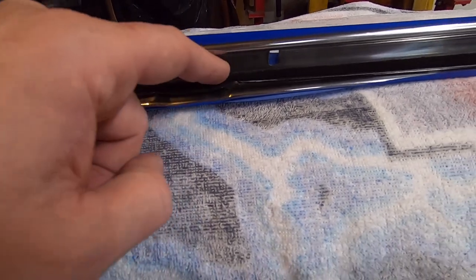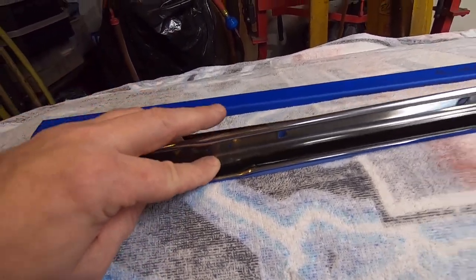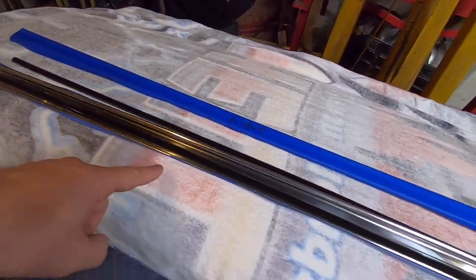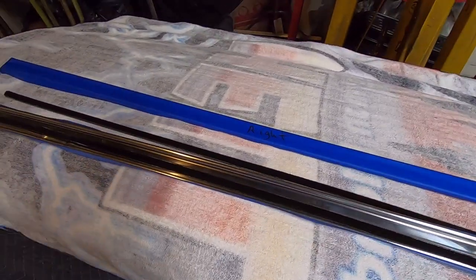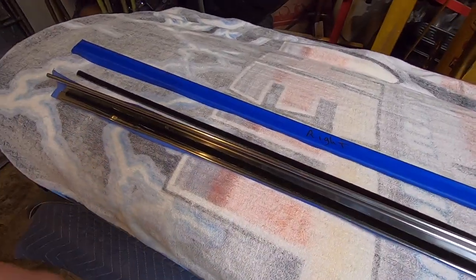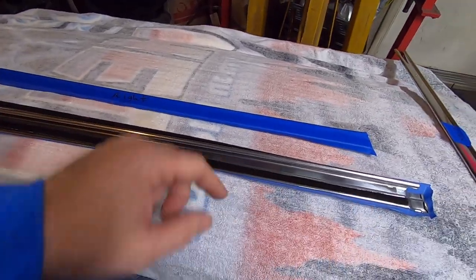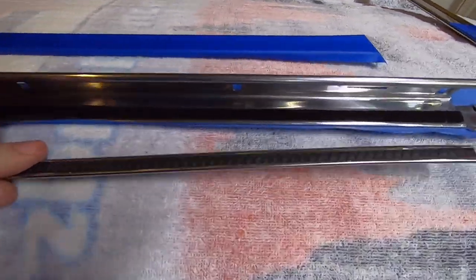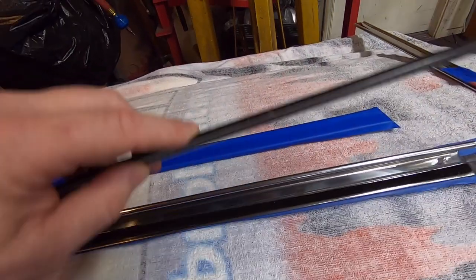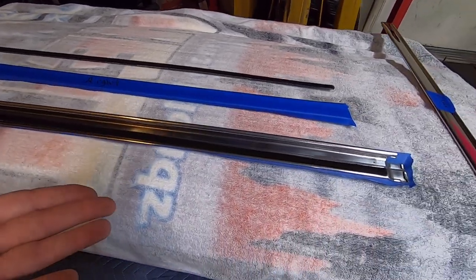This front part up here you have to bend it — it's not too much fun, but it's just you gotta mess with it to get it in there. If you want to go through there and open up that rolled edge and try to bend it and beat it all back down, more power to you. I'm not gonna do it — I don't want to tweak this out and warp it all out. So anyway, pre-fit your felt strips. You can see my grinder mark here where I just flattened it off, and it makes it thin so it'll fit down in behind that rolled edge.